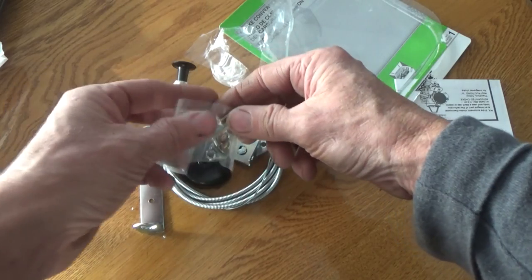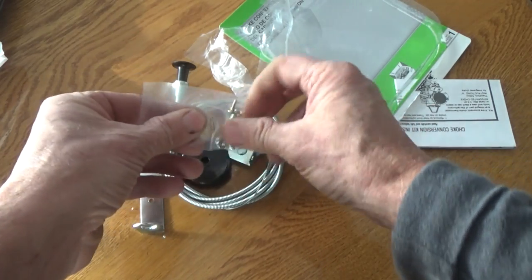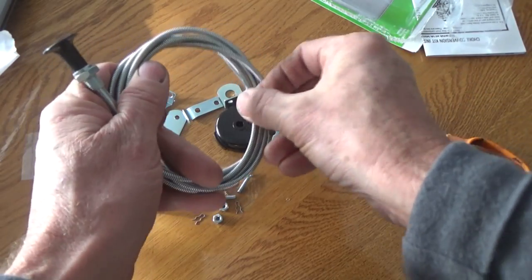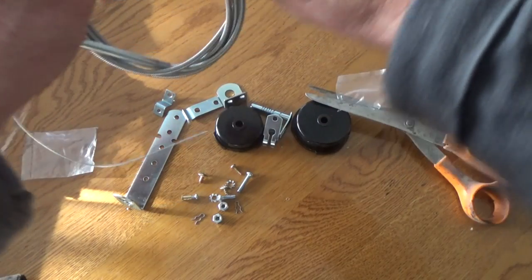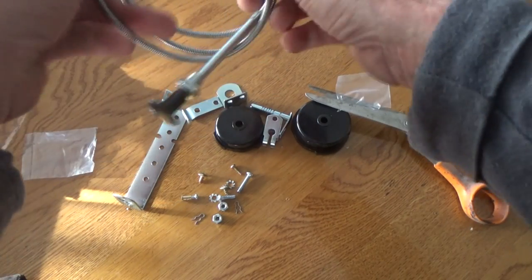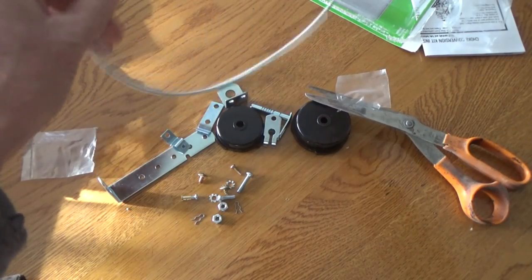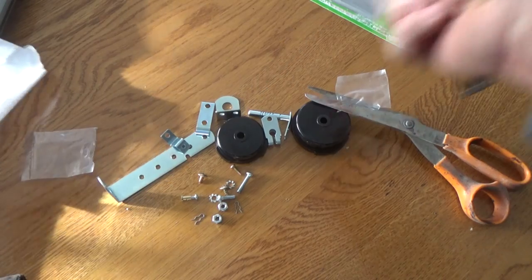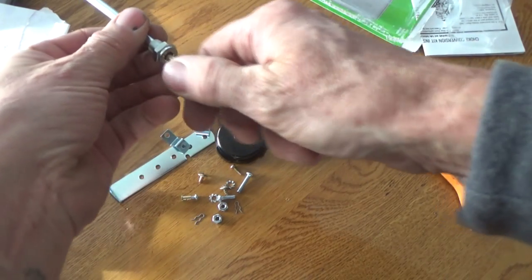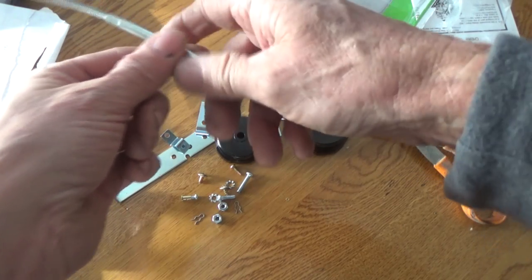So the computers are the ones choking the car. I'm going to look at what I got here first — put everything right here so I don't lose it. We got the hand choke, we're going to kind of open it up and see how much room we got. Very simple — all this is a cable, like a bicycle cable or brake cable. Push it out, got your choke; push it in, no choke.